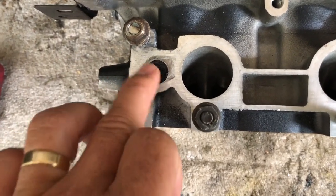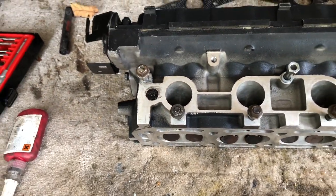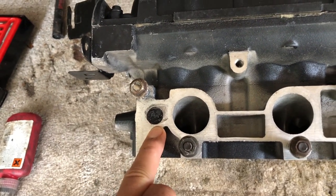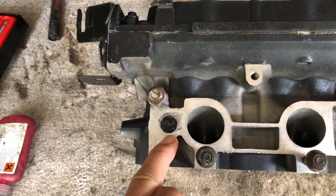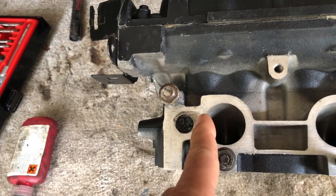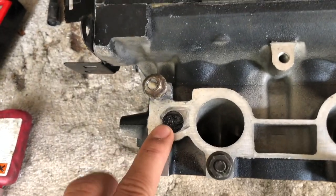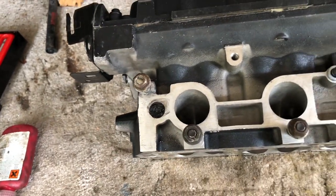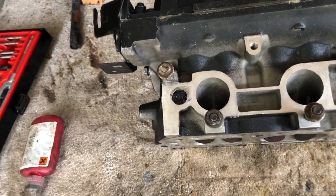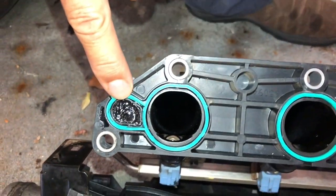The little thing that's probably worth doing is plug this water hole over here — it doesn't actually go anywhere in the manifold but does have water sitting in it. I did notice even on the MG6 manifold I've got, there was very slight white marking showing water was leaking out very slightly, and the rubber manifold gasket was slightly bent around this area. Just sealing it with a silicone plug and allowing it to dry before you put the head back on is probably not a bad idea and certainly can't do any harm — it should prevent any leak. Do a similar thing on the inlet manifold itself, making sure it doesn't protrude above the surface.